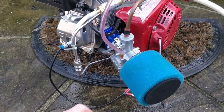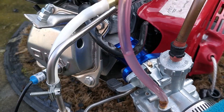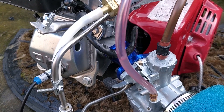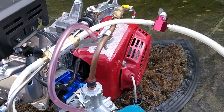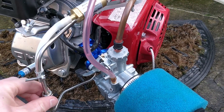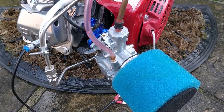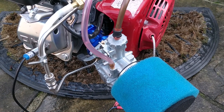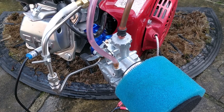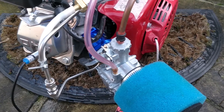So now I've put fuel in the float down here — you can see the fuel level there. I'm going to run the engine, and as soon as it starts to run out of fuel I'm going to open the valve that allows the hydrogen gas to go in. The reason I'm doing this is because if I run on pure hydrogen without any oil or fuel on the intake valve it seems to backfire at the valve — might be a valve issue. But this would be like an alternative to LPG gas. Running the engine on petrol first seems to make a better seal around the intake valve. So we'll give this a go now.